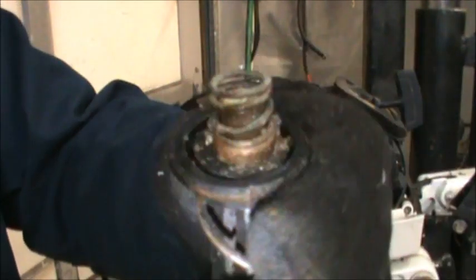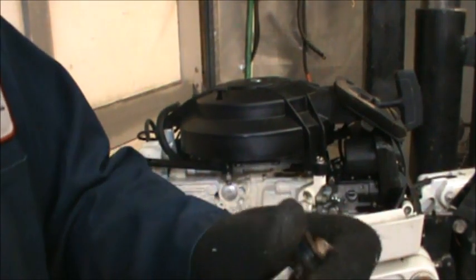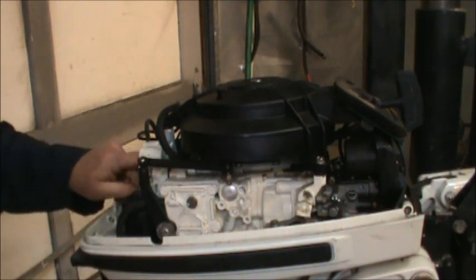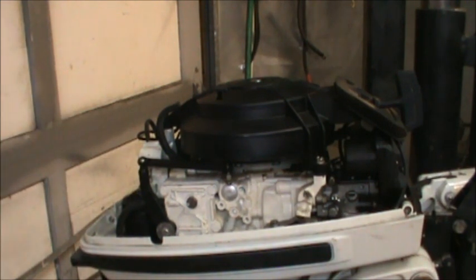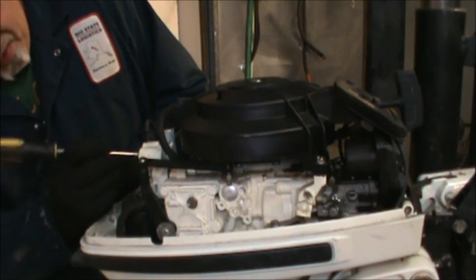It's pretty yucky. But I was able to save the grommet part and everything. I don't know that thing was working. And it's got a bunch of yuck inside it. So what I'm gonna do, I think, is put this thing back on there and run it a little bit without the thermostat. If nothing else, flush all this crap out of there.